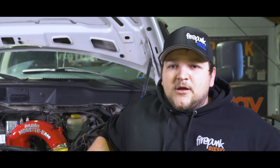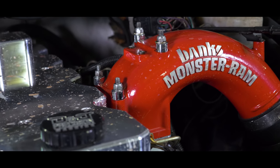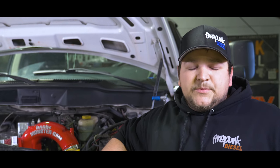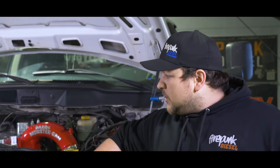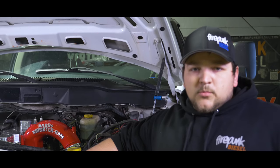We've got Mackalveen's truck on the dyno again. He was here at the beginning of January, about a month and a half ago. He upgraded his injectors to 100% injectors and a 12mm CP3, trying to get it dialed in and get his EGTs in check for towing since he uses the truck for hot shot work. We'll be air-limited today as far as making peak power since he still has an S363, but we'll mess with the tuning and see if we can get it dialed in.